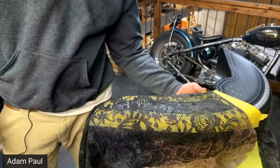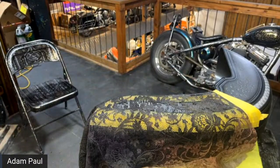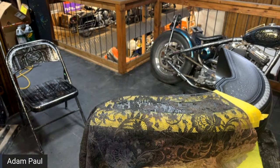And then someone said, what size of flake is best to add to candy paint? Usually you don't add the flake right to the candy. You would spray it on beforehand like this. The size I would use is 0.004 and 0.008, which is what the Limeline metal flake is. That already comes in the same packet. So the Limeline packet is what you're going to want to use, and then the candy over the top.